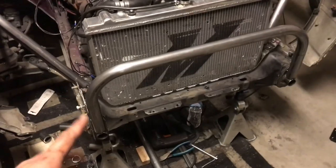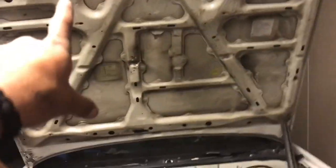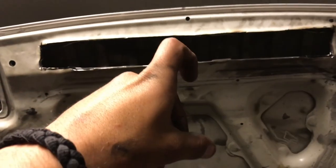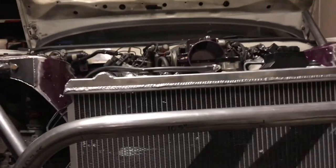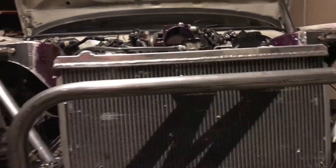Now I'm going to move on to making the bars that go across from here. Sad to say I had to redo it — I had to make it shorter because if it was even with the radiator, it kind of hit my hood. So I cut that out — the little hook that hooks onto the latch. I'm going to use pins going through the hood to hold the hood down anyway. Instead of being level with the radiator, it's now about 3 to 4 inches lower.